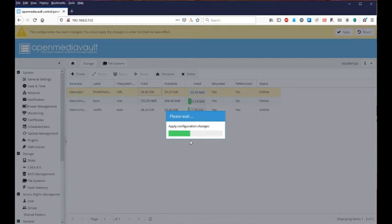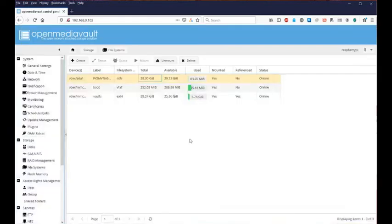Another quirk I've also encountered is when you try to set the static IP, it sometimes doesn't work either. So if you've set it up properly at your router, it's not necessarily anything to worry about. One of the things you can do is use a DHCP reservation to make sure that the DHCP will only give your Raspberry Pi the IP you want it to. Because most people want to keep DHCP switched on, to be honest.